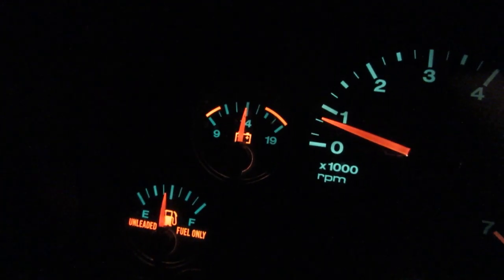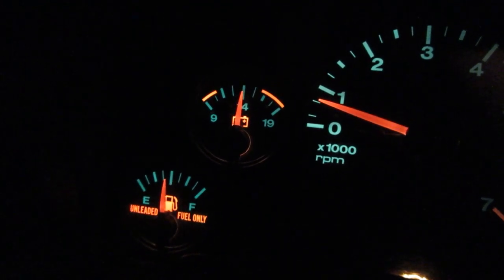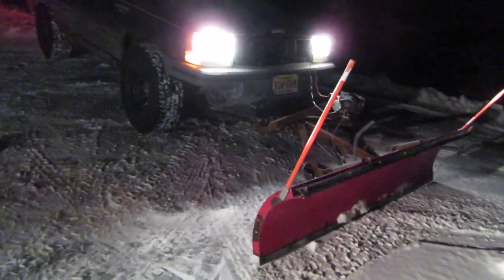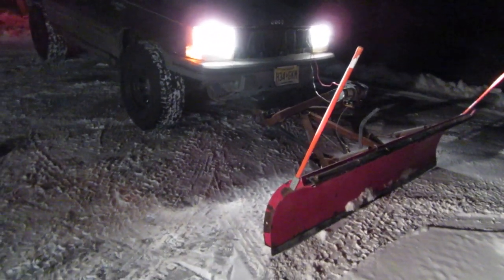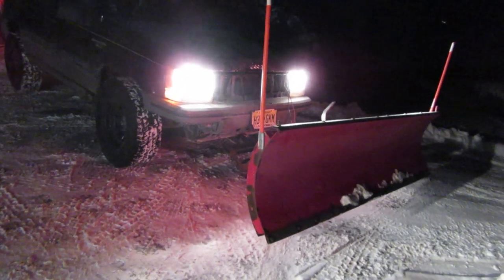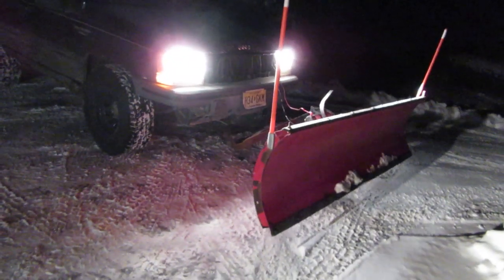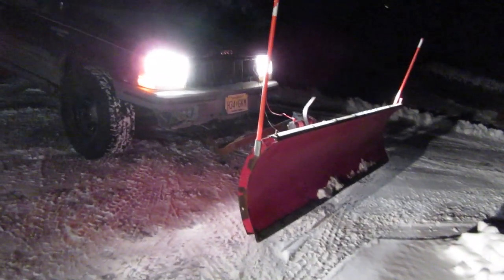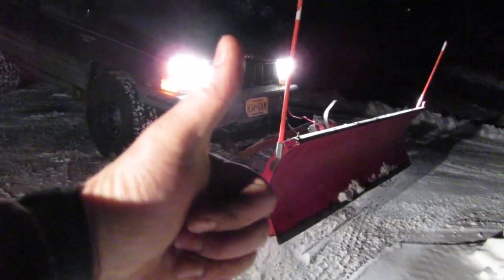Showing about 15 volts charging, and we're moving inside. The alternator is charging, which means we have properly hooked everything up. All the wires are where they belong. This Jeep is properly communicating with the new alternator and that new alternator is in fact charging the battery. And what does all that spell? More winch power! Moving this seven-foot plow used to absolutely drain Eric's battery — the voltage gauge would drop down to nine and it would just struggle. Now the new alternator is pushing enough energy that it's a hundred times better. As he's pulling the plow all the way from the ground, his gauge is not moving off 14 volts. That's exactly what we were trying to do.